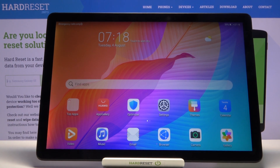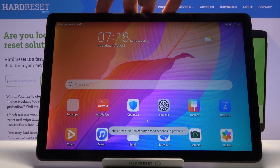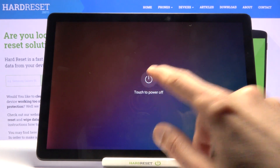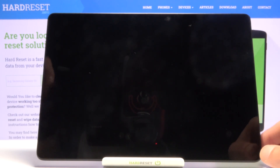To get started we will need to hold the power key. From there select power off and wait for the device to shut off. Now once it has, you want to then hold the power key and volume up both of them at the same time.